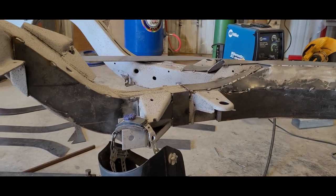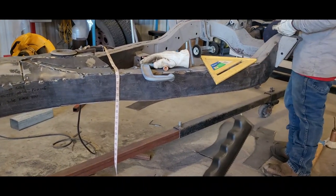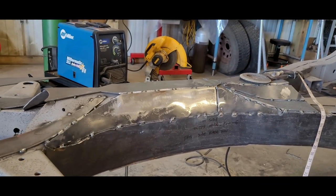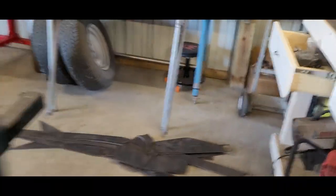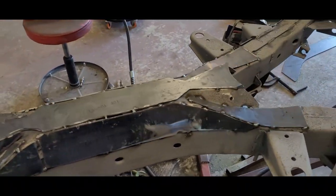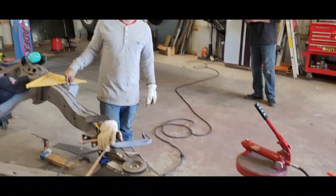So we're moving right along. We were debating on cutting the body mounts off but opted not to do that. So we're going around them — the pieces that came with the frame wrap were designed to cut the body mounts off, so we basically had to modify those pieces. The X section was a little tricky — we had to bend them a little bit. So far we've got the X top side, one side on, and the two transmission pieces on the inside. Overall I kind of like the kit — it needs a little trimming but he said that upfront, so it's not like it was going to just fall into place.